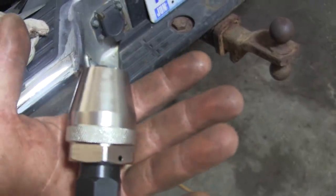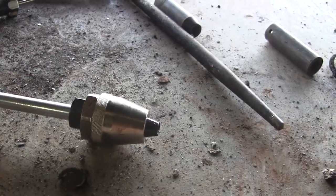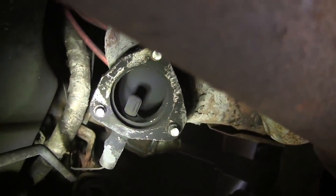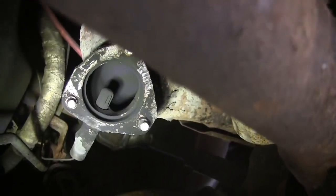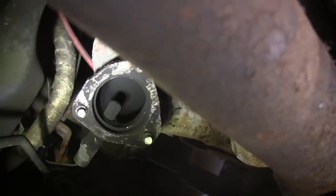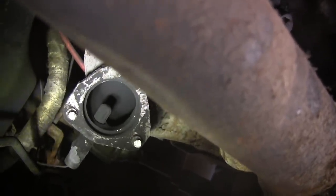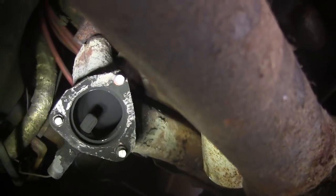Let's give it a try on those really bad ones first, because if they don't come, I'm kind of screwed. Well, that little tool works pretty good — unfortunately it works too good and it snaps them off, and then it doesn't close enough to get on the very little nib of that stud. So those studs just aren't coming out. I could take the manifolds off and screw with it, drill them out or grab some vice grips, but I think I'm probably just going to get headers for it. Why screw around with all of that when I can get a set of headers for next to nothing? Plus it would be a performance upgrade, so yeah, I think we'll go that route.